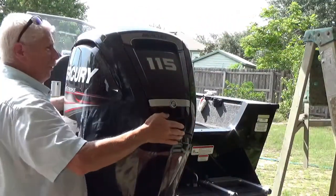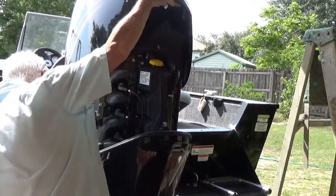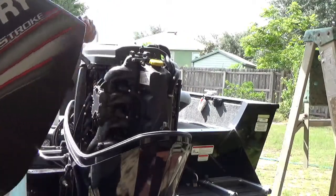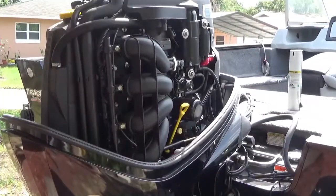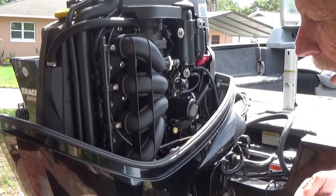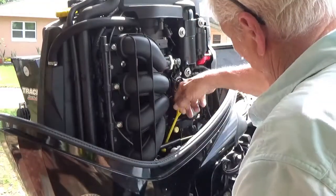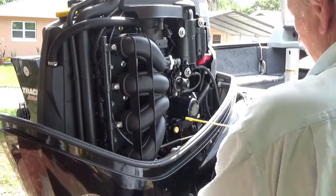Let's see if I'm strong enough to pick it up. These four-stroke engines they've got now have a dipstick in them just like your car. They want you to check it before you do anything with this boat. You pick it up and check it, pulling it all the way down, then pull it back out and see how much oil you've got on there. Mine's just right, so you don't have to worry about that.